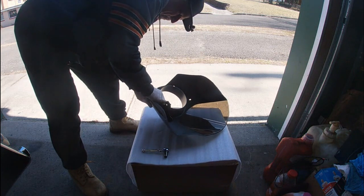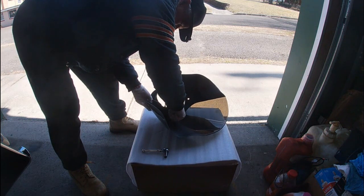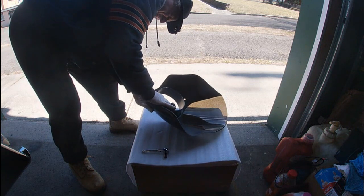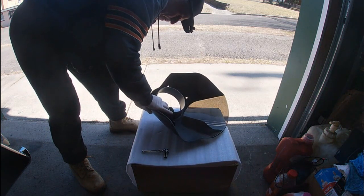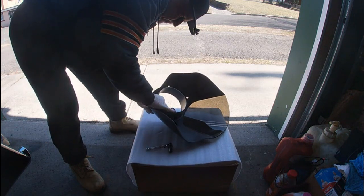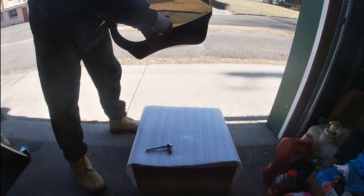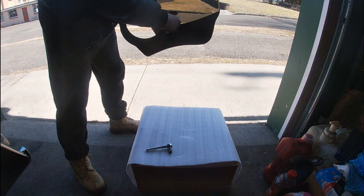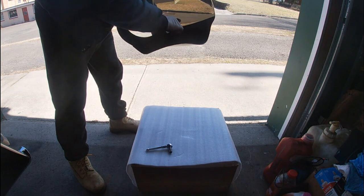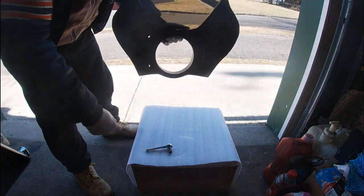And like I said, they are aluminum, so you don't want to strip them. You don't want to go overly tight anyway. So you just want to be in your keyed position to help hold them in place. I think I can get a ratchet in there. So it's going to be a 10 millimeter wrench to do this job anyway. And then this one here, just going to run them in finger tight is all I want. Okay? And that gives me movement back up and down, which is what you want. So that's one side. You see how that's on there.